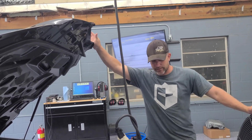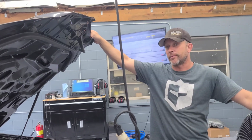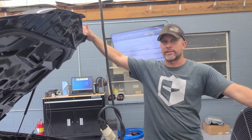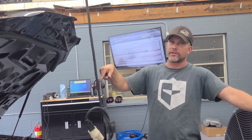Chris had the air fuel dialed in, and then they went up the street for a drivability tune and noticed the fuel pressure was dropping off. There was a fuel pump failure, so he fixed that. It has the dual in-tank setup with the return style system. He's using the factory feed line as the return.